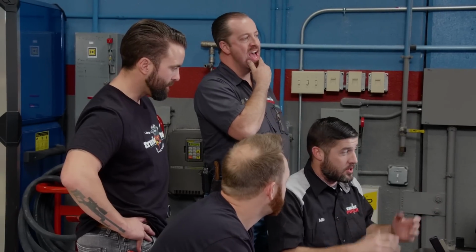Wow, 220 horsepower. So these came from the factory with like what, 165, right? Yeah, 160, 165 is what we looked up. This thing has way less compression. It does have a better flowing head, but other than that, it's already 60 horse above what it came with. Yeah, not even 8-to-1 on the compression. All right, all the vitals, everything looks good.